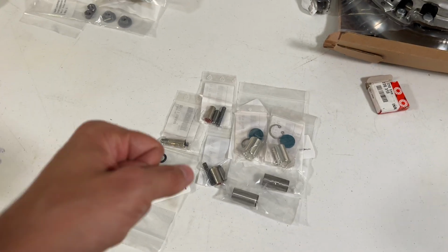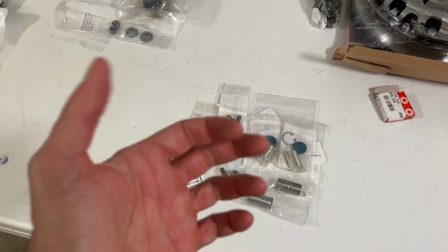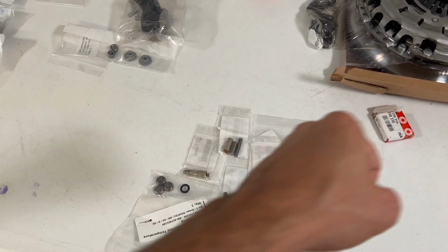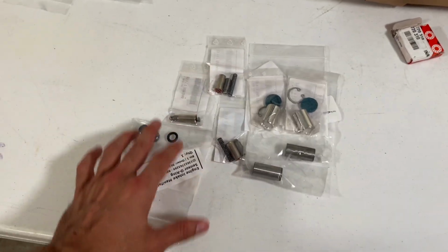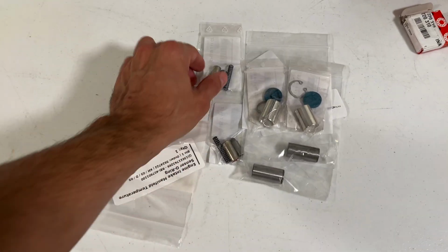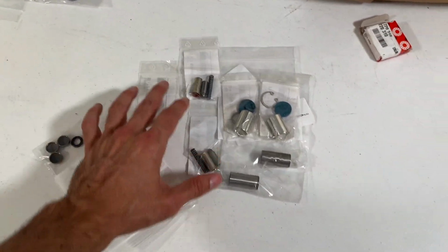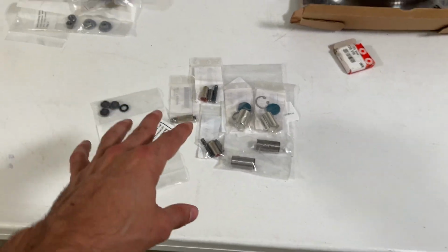And then when I'm shifting quickly from second to third, when it still has that lean and the transmission hasn't warmed up yet, I go to shift into third and the lean will actually pull me sometimes into fifth. So by replacing this, this is a BMW upgraded part actually. These are new BMW components. They now come with a sleeve. They've been upgraded to never have this issue again. So this is actually more robust now with this new piece.